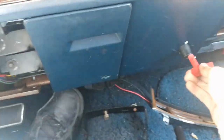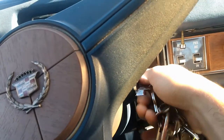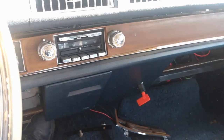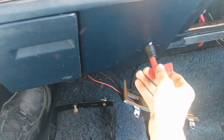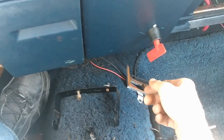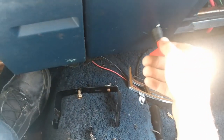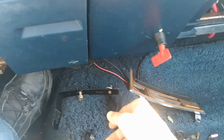Nothing. That's what we want for now, until we put the key in. Should it work now? Oh yeah, that's what I'm talking about. And if something were to happen... Oh yeah, that's right. It's the equivalent of unhooking the connection to the battery by doing that. I thought that would kill the motor for a second. No, this is the attempt of just taking the connection off the battery. You know, the reason why it's still running is because the alternator is good.